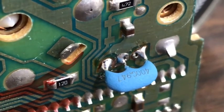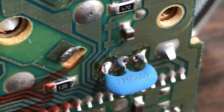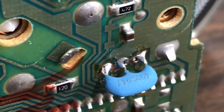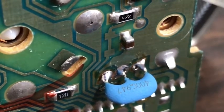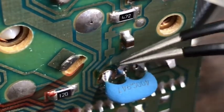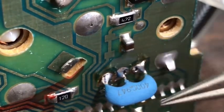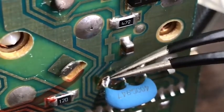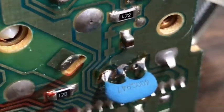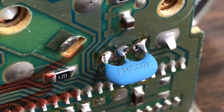You can look up a how-to soldering video before you get started, and you can purchase a soldering kit for about $10 on Amazon — I'll provide a link in the description below. During the soldering process, I created three holes where the previous piece was and stuck the new piece with its three legs through the holes. Make sure those three bases are not touching each other, as that could cause a short whenever you get this back into your vehicle.